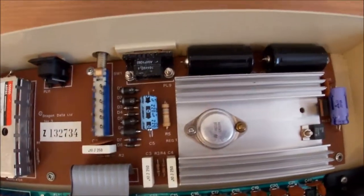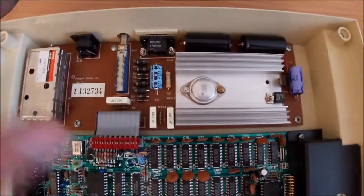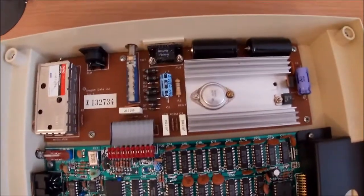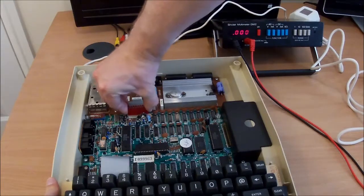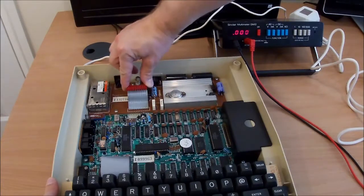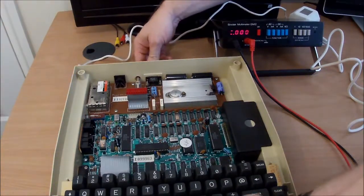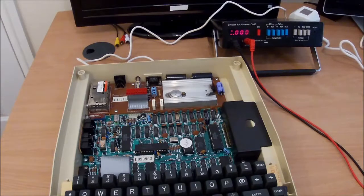That's our power switch. Yeah, I think what I'll do, I'll disconnect this, I'll put power to the power board and I'll take some measurements with a multimeter, make sure everything's working there before we put power to the main board, because who knows how long this thing's been sitting for. Let's just disconnect you. Right. Something to probe. Power on, plug it in, see what we get.